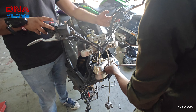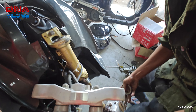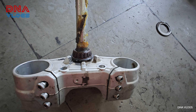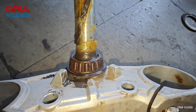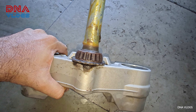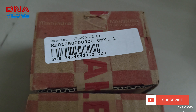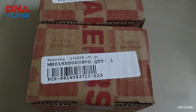Once this is off, we can move the handle and T very easily and change the cone set. We removed the two bolts and the T has come out. Look at the condition of the bearing — see how rusted it is. That is the reason why the bike was getting stuck at certain points. That's the condition of the top cone — it's completely rusted.